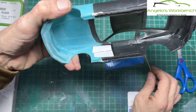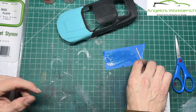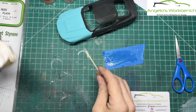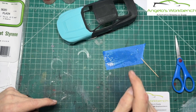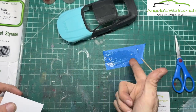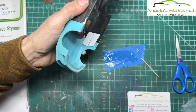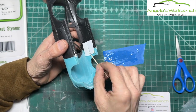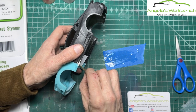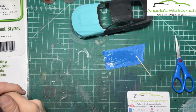So there's what I've got. Once that hardens in five to ten minutes, that is going to be a wonderful bond. I leave the tape out here because it was mixed and applied at the same time, so I can see when the resin starts to get tacky or when it's fully cured — right there on the tape, without experimenting on the body. It's always when you take one more look that you see something you missed. But this looks fine — it's going to result in a marvelous bond, and then I can sand on it without worrying about breaking it apart. Fingers crossed.